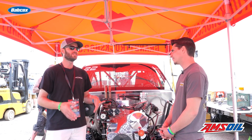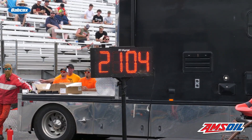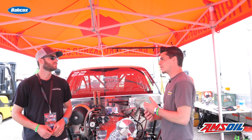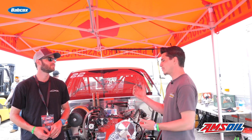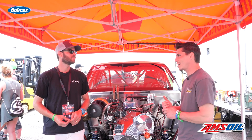Drag racing was yesterday, today's a dyno competition, and there's been a number of guys up there already getting a little over 2,000 horsepower. How are you feeling for today? I'm not really sure — our horsepower calculator shows we were around 1,800-ish yesterday going down the drag strip, which is a respectable drag racing number, but that's not going to get us on the podium on the dyno. So this event we're going to fuel it a little bit harder and see if we can do a little bit different things with the nitrous. We were getting into the lean side on the nitrous, which actually started to cool it back off — it seemed like it made a little bit less power once it got lean. When you upped the jet size, you wouldn't gain as much as when it was in a really rich condition. It makes a lot more power when you hit it with the same jet in a really rich condition — it picked up a ton of power. So we richened it up a little bit and we're going to run the same jets and see if we can make that 2,000 horsepower number.